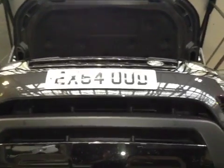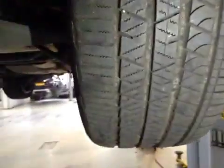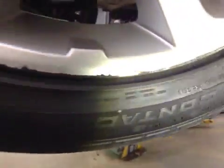Hi, my name is Tom. I'm doing a health check on your Range Rover Sport today. Starting on the near side front, the tire has 6mm of tread but there are multiple cuts to the sidewall that don't go to the cord, making it marked in amber. There's 5mm of pad, also marked in amber.